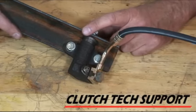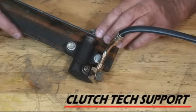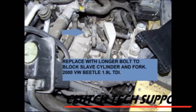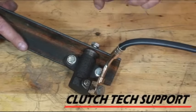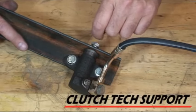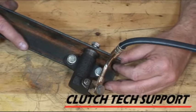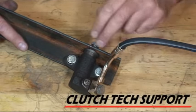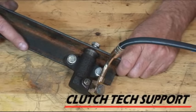And we change it and we start to get a flushing action from the top down. I've actually done this technique at home on a Nissan pickup truck — this really changes how it works. It doesn't work on every vehicle, but I found out that on my Volkswagen Beetle you can actually do it because there's a bolt hole in the transaxle case that keeps the push rod and fork in position during the installation process. So if you take that bolt hole and drop a bolt down in there, now as the slave cylinder pushes out a little bit, you're blocking the fork with this bolt. Push moderately — just hand pressure on the master cylinder through the clutch pedal — and you create the same blocking action instead of just letting the diaphragm spring push back and give you a little burp out of the slave cylinder. Blocking the slave cylinder dramatically changes how this works.